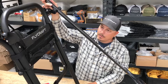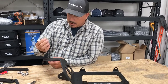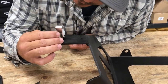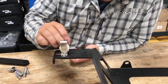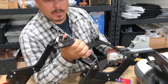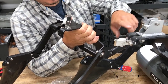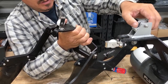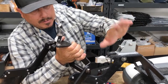That should wrap up the install on the gear tower. Next, move on to the gravity fin. Start with the pulley system — line that up with the holes, which are on a slight angle to drop the rope perfectly center through the rear slot. Take these short quarter-inch bolts, slide them in, and install the nuts. The gravity fin also has an option to run the anchor without the gear tower — you can reinstall this pulley piece on the back, and in the future there'll be a cam cleat stopper available so you can run your anchor with just the gravity fin.